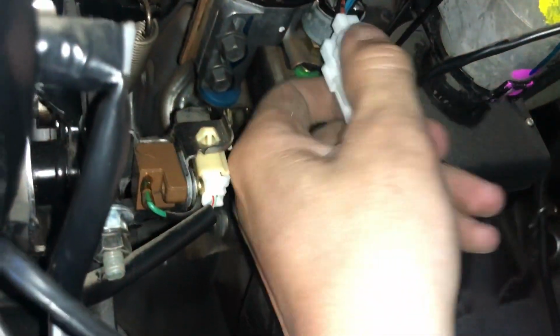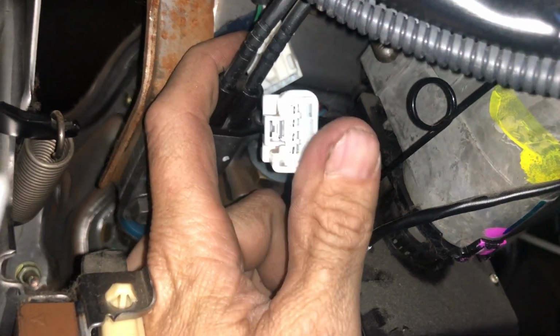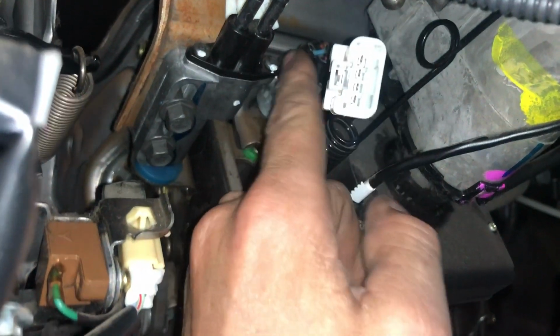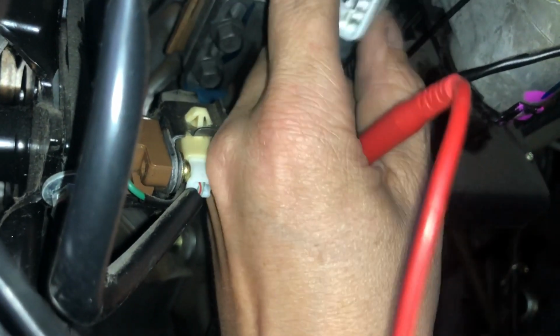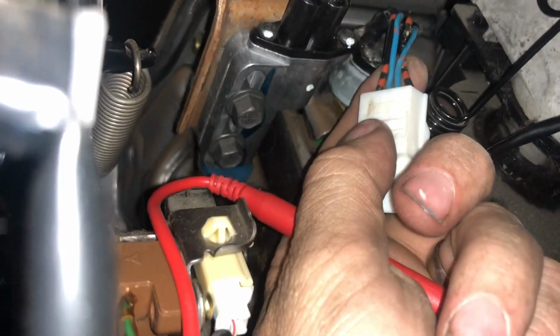All right, so I want to show you which connector is your cold side. This is the brake pedal. I've got the panel taken off. It's the only way to get to this. So I've disconnected the two just for access. But the one you need to connect to is this. It's a brown with a black tracer. Now there's 2 identical wires. They're both brown with black tracers, but they're not the same. This upper one right up here, that's your cold wire. That's the one you got to connect to.